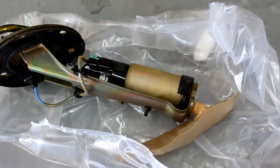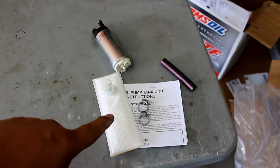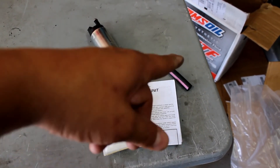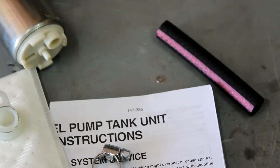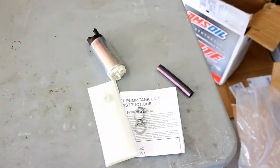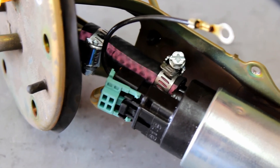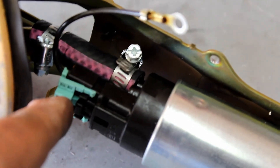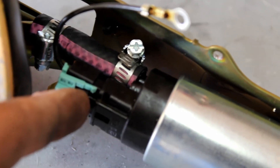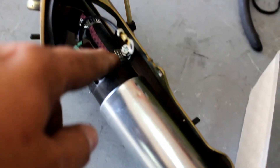Here's what comes in the kit: you got the pump, the strainer, two clamps, hose, and a tiny clip that holds the strainer on. Start by unplugging the old pump. To get the clip out, you have to raise up the green part first — that's the locker — then you can push the black tab and pull the whole connector out. Now I'm back to putting it back in; I had to cut about a half inch off the hose to make it fit right.